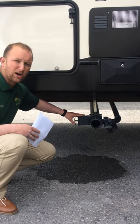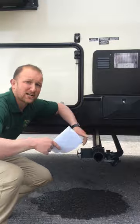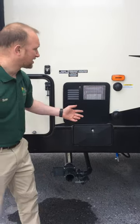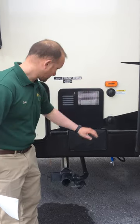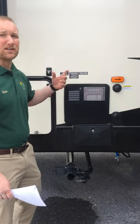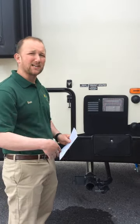Once you have done this, your camper has a black tank flush on it, which is right here. So once you've emptied out your black tank, it's a good idea — you're just going to take your water hose that you use at your camper, and it's going to screw right in there. Make sure your valve's open and your sewer hose is on there, and you're just going to let that run for a couple minutes. It's just going to help clean out your tank and clean out your hose.